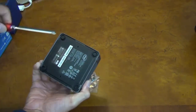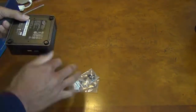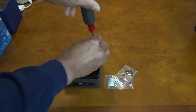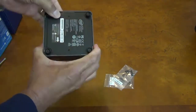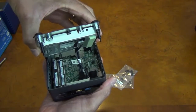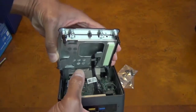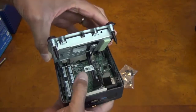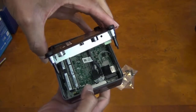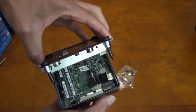To install the memory and disk space in the Intel NUC, you'll need a Phillips head screwdriver. There are four feet on the bottom of the NUC you'll have to unscrew. When you get the base unscrewed, you'll see two cables connecting the base to the chassis. It makes it easier to operate if you disconnect the wires from the motherboard.